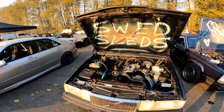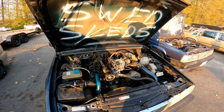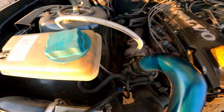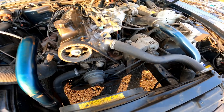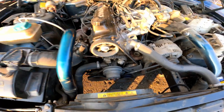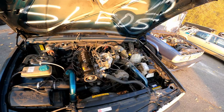Guys, so we're getting near the end of the day, and it's been a great time. Oliver's engine is sounding a little bit weird. He went off the track, there's a lot of sand, and it went all over his engine bay. You can see it's all in his frame rail down there, a bunch near the head. But we're a little bit worried because he's not running a rear timing belt cover or a top one. A lot of sand definitely went down into the timing belt, and his engine's making a bit of a weird sound now. So it still runs fine, but we're not too sure.